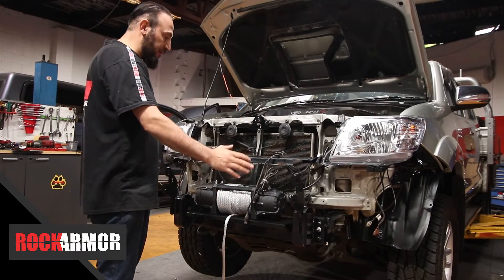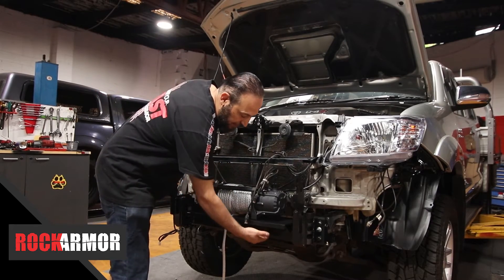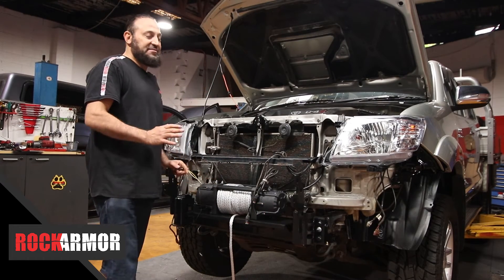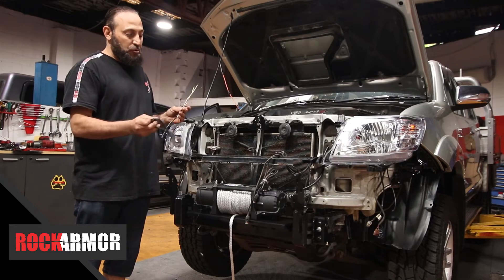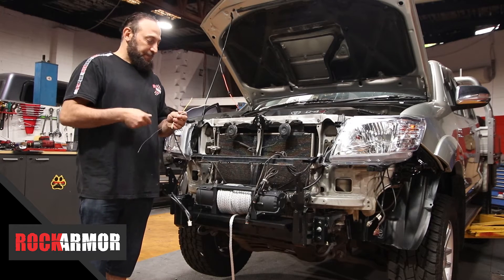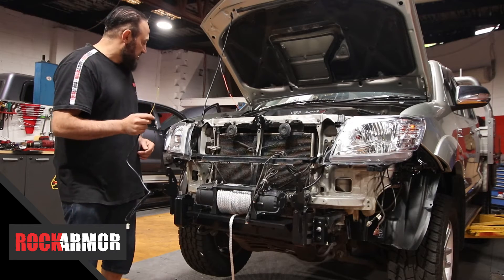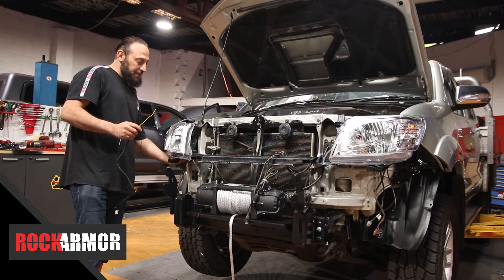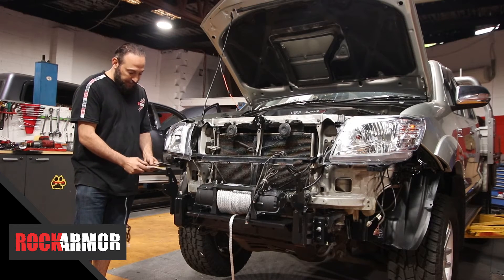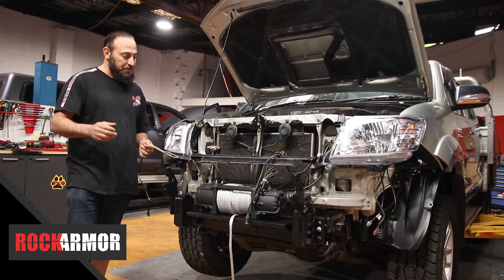Okay, so I've gone through and tightened up all my nuts and bolts — that's all solid. I've put the winch in place. You see you've got your four mounting points on the bottom and they line up with the winch, so I've tightened all that up. The next step is my wiring. Inside the bull bar connected is this little wiring harness — the black is our negative, the white is our parker, and the yellow is our indicator. I'm going to tap off into the factory lights. This vehicle is a SR5, so I'm just going to pick up from the factory fog lights and connect them straight to the fog lights on our bull bar.